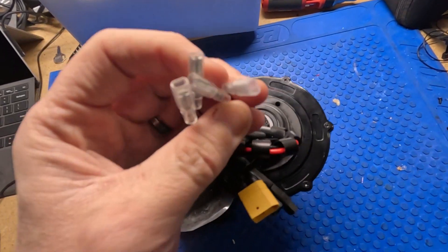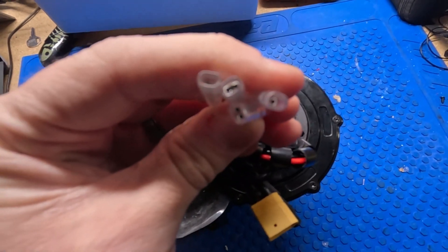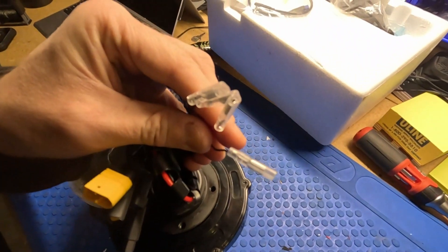It'll look like it'll have a headlight and brake light, which is kind of cool. It is interesting that these are spade connectors, because they recently started going fully to JST connections. For the longest time the BBSHD came with JSTs and the BBS02s came with spades, but lately all of the BBS02s and HDs were coming with JSTs. So I'm curious to see if the new BBSHD is going to be switched over to spade or stay JST.